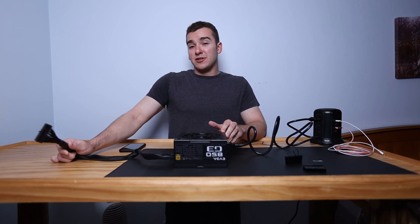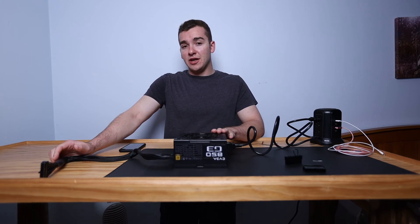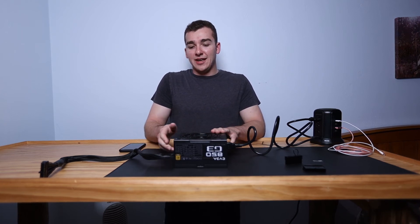When I was building my water-cooled PC, I hooked everything up and went to jump it to get my water pump running — and nothing would happen. I'd hear a click and nothing. I tried plugging the motherboard cable straight into the motherboard and the RGB lights came on, so I thought the PSU was okay, but the system still wouldn't power on. Long story short, I had a bad cable — cables were mispinned — and the power supply knew something was wrong.